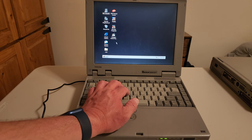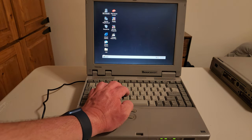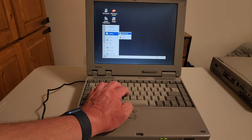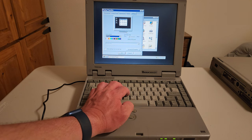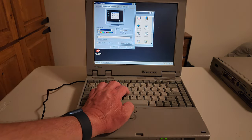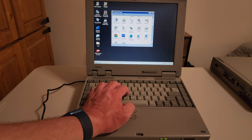In Display settings it's at 640x480 with 16 colors — we don't want 16 colors. Let me change it to 800x600 and high color. I'll also go into System Properties to see if any drivers actually did install and check Device Manager — that shows things not configured correctly.